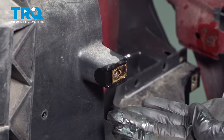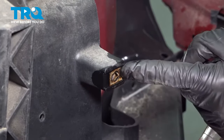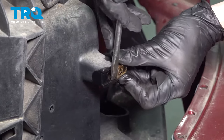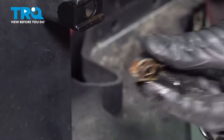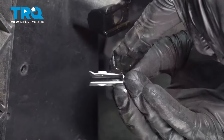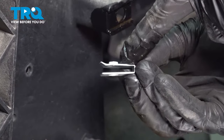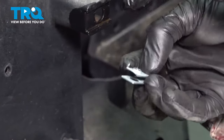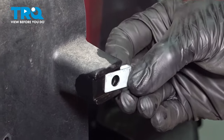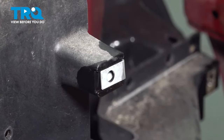Before we go ahead and put our headlamp back into position, let's make our way to each of these clips — pop those right out of here, you can use a screwdriver for that. Once you have it out of there, you can put in your brand new clips. Looking at the clip, you can tell that you have a raised edge — that's where the threaded area is, and that needs to be facing on the inside. So you have the blank or hollowed out area facing towards the front where the bolt will go through.